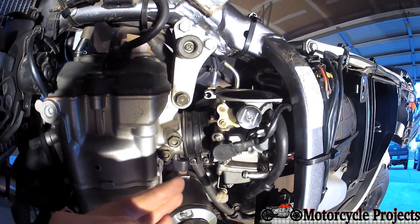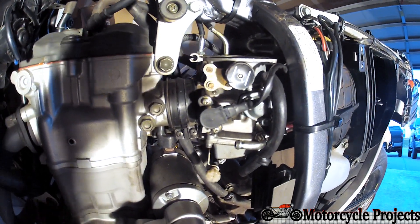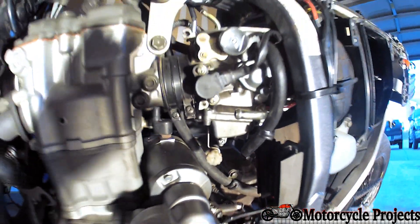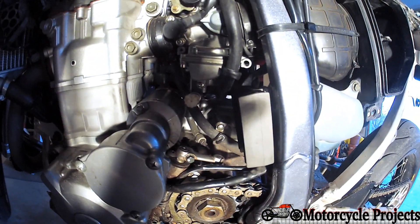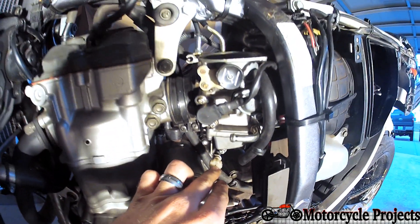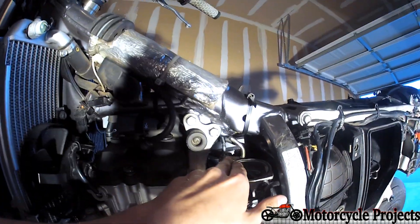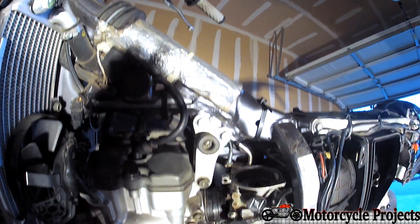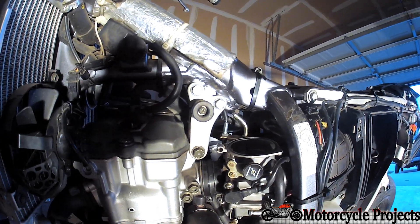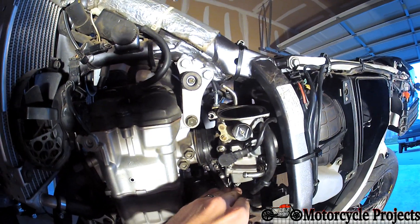This is the fuel barb, where fuel is allowed into the float bowl of the carburetor. This is your drain screw, which has a small tap off the bottom that fuel will dump down onto the transmission casing. And this is your idle adjustment screw. It doesn't adjust the throttle plate like some carburetors — it adjusts the throttle cables so they're resting on a certain position, essentially holding the throttle always slightly open. You can also adjust free play slack on your throttle cables with this, so it works very nicely.